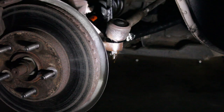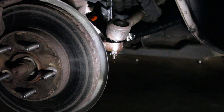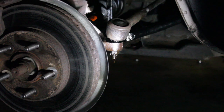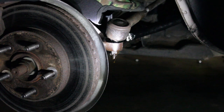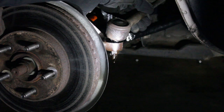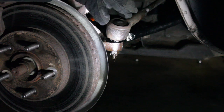So we got that bolt loose now. The next thing — you don't want to loosen this too much because that's our alignment. When we put the new one on, given that it is an OEM replacement, it's going to be pretty close to the original alignment. Just loosen it a little bit and then tighten it so it's barely touching — it'll give us a good reference point when we install the new piece.